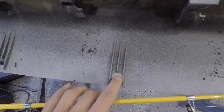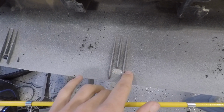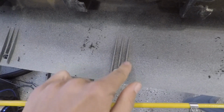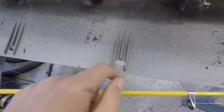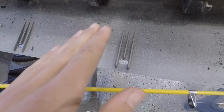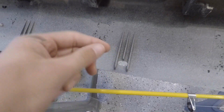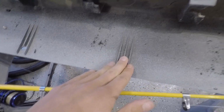All I ended up doing, I don't know if I mentioned it, but all I ended up doing was using the factory clips on the bottom, and I can show you right here. These holes, they didn't line up for me because I didn't really have it pushed on all the way. So these holes, I ended up widening the holes a little bit to make it a wider slot, and then I ground down this section here, and on the other side too there was something that I had to grind, and that allowed me to push it up really close, and then I was able to get the clip in to the factory hole underneath the car, but also retain the rigidity of this.